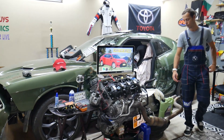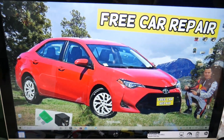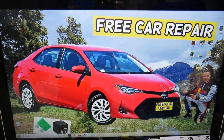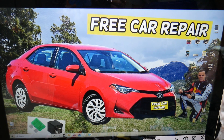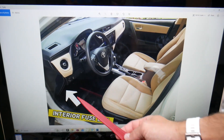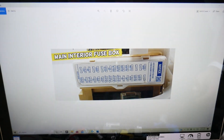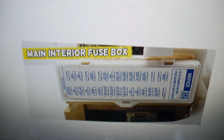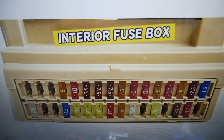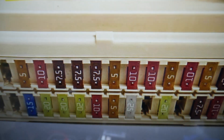Now, the rear window wiper fuse — if you have the hatchback — here's where to find it. We'll demonstrate on that generation Toyota Corolla; the hatchback will be the same, just a different shape in the back. You have multiple fuse boxes. Today we're working with the one on the driver's side. Open the door and look under the dash, all the way at the bottom, upside down. You'll find a white cover that looks like this one — pop it open, and behind it you'll find the main interior fuse box with a layout like this one here.